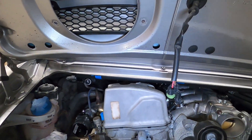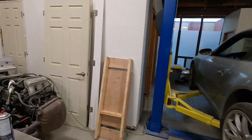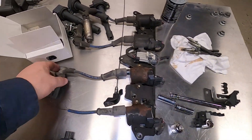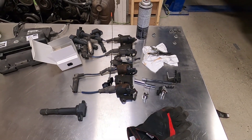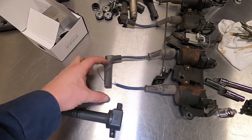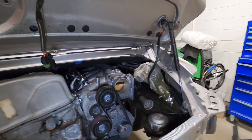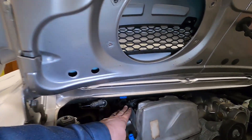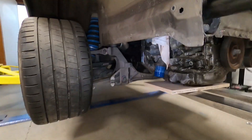It fits, the trunk closes, everything fits. Doing this changes a few things with the ignition — I can no longer use the Honda ignition coils like this one, they're just too tall. So we're going with a set of GM coils and a set of spark plug wires like this. I can make custom ones, so I'll be making custom ones once I finalize the position of the GM ignition coils. Considering how short and stubby these are, once I find the right length they'll have no issue clearing the top of the engine bay. Just got some final modifications to do to the valve cover and make a flat top piece of aluminum that goes across with the proper holes for screwing it down.